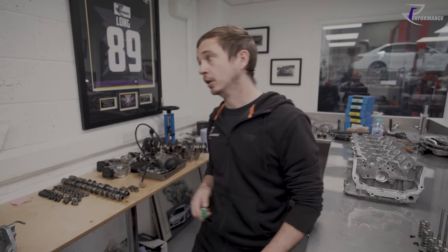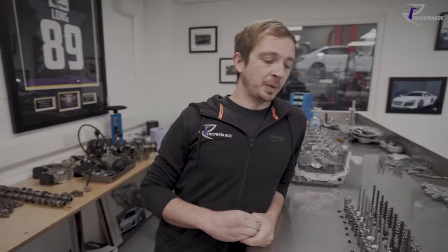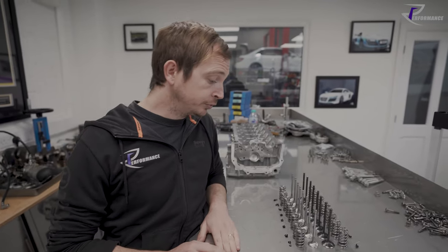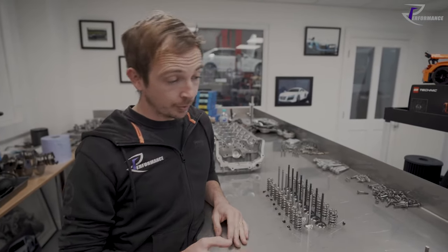You think boost pressure gets high. They're not running big boost on the stuff over here, but exhaust manifold pressure goes through the roof. And that's what a spring has to fight against. And if you get it wrong, you get a car that doesn't run very nice, and you start damaging parts, and you start damaging engines, and you lose performance.